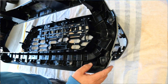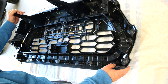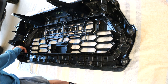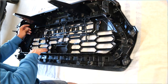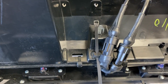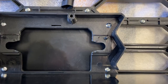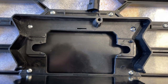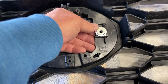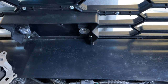Installing the new grille insert is pretty easy — you just have clips now to hold it in, 16 in all. Just line up the surround matching up the clips until you see all 16 in line and start clicking away. Do a quick verify that all clips are seated. I opted to clean up some of the wiring for the Raptor lights and installed the wiring harness for those lights. I also reused one of the factory zip tie slots for the TSS sensor. You will need to remove the silver nut inserts from your stock grille and install them in the new TSS sensor bracket.